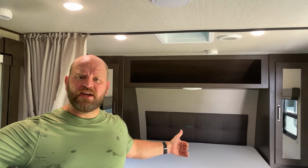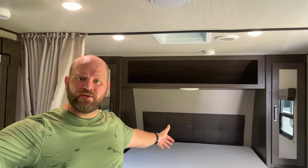It is. So if you're looking for something in the little over 20-foot range, the inside of this, nose to tail, is 22, and then with the trailer tongue and all that, it's 25 feet. Nice, easy to pull. This is kind of the opening line for Grand Design. The dry weight for this is around 5,000. It all varies depending on when it comes off the line. But then I believe the gross weight is around 6,700, 6,800. So you've got a good amount of weight that'll work on the axles. The good thing about the weight distribution is that it only has about a 500-pound tongue weight. As we all know, the payload capacity of your truck is what gets eaten up first.